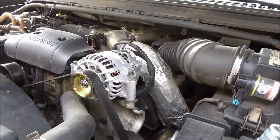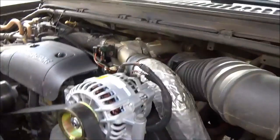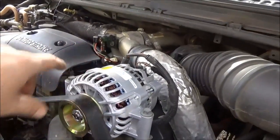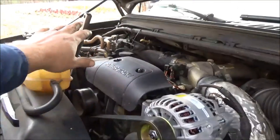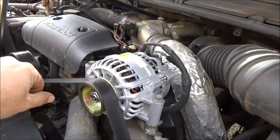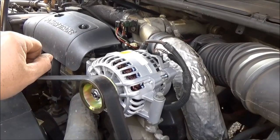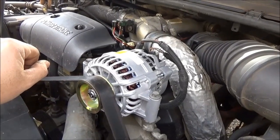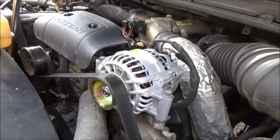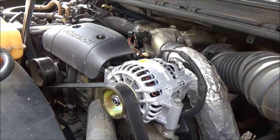Let's go get an alternator and let the batteries charge up. In reverse for reinstallation: charge the batteries up first, then put the electrical connections in first, then the three bolts, then the tensioner with the breaker bar. Very easy, five minutes tops to put the alternator back in. This is on a 2002 Ford F-250 with the 7.3 liter diesel — one of the easiest change-outs on this truck.